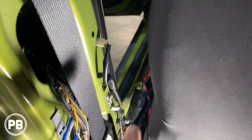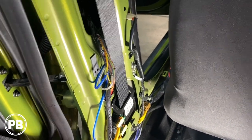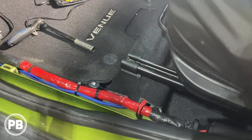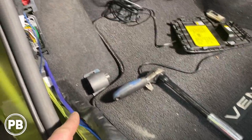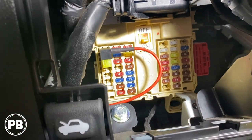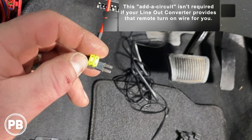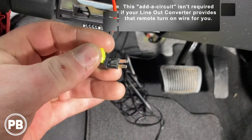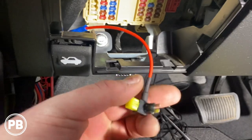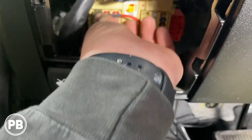The signal goes through the line-out converter to the RCAs, which go to the amplifier input. We re-loomed the harness and reinstalled the B-pillar. Note: there is actually a factory ground in the B-pillar if you don't want to tap your own. For the remote turn-on wire, the blue wire from the amplifier runs up to the fuse box — the top-left fuse is the power socket fuse, only on when the key is on. We added an add-a-circuit in the first position with a secondary fuse on the remote line, crimped on the connection, and it plugs right in to provide the remote trigger signal.